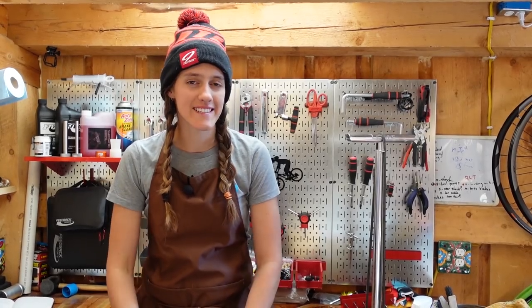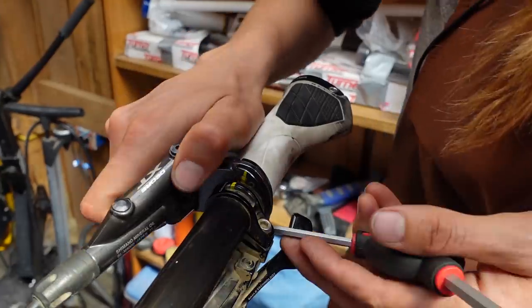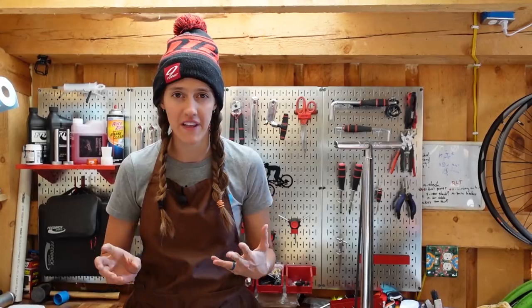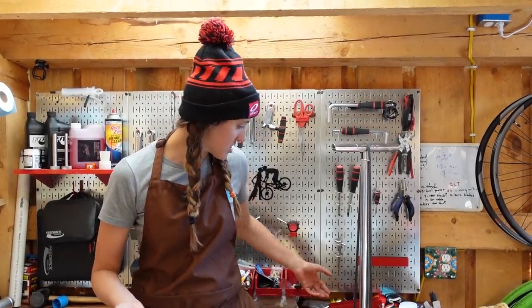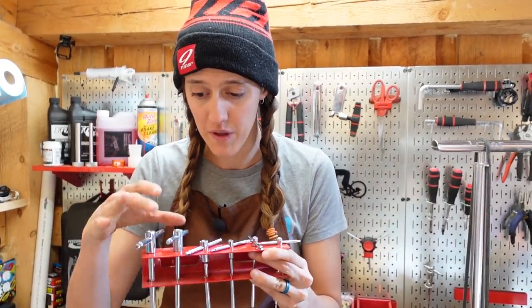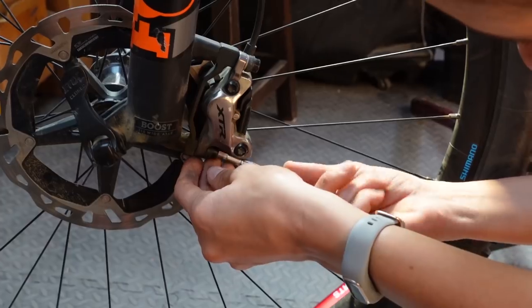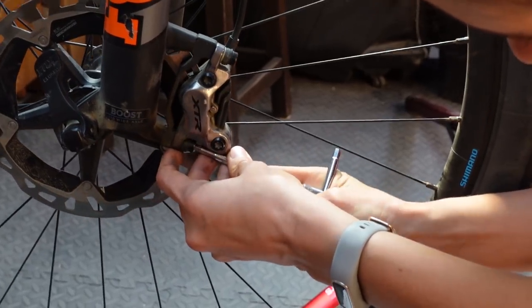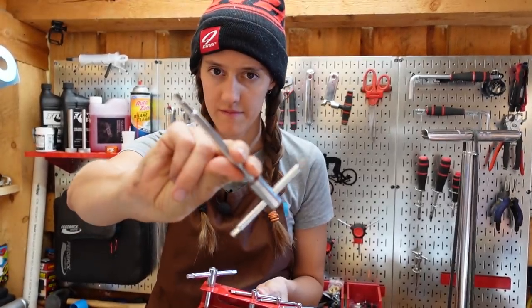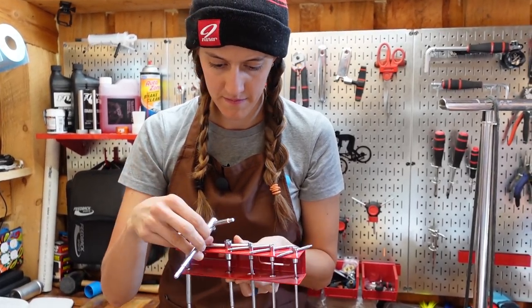Our second category is adjustments. You want to be able to adjust your saddle position, everything on your cockpit, your seat height, your derailleur, centering your brakes — all that. To do that, you pretty much need a decent set of Allen keys. You can do a lot with a multi-tool, but having long-handled Allen keys makes a huge difference. They're longer so they can fit into places a multi-tool sometimes can't. They're stronger, less likely to strip out the bolt, and less likely to strip themselves. It's just worth getting a good set of Allen keys.